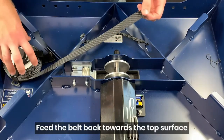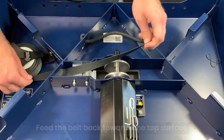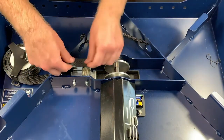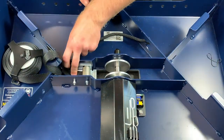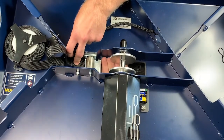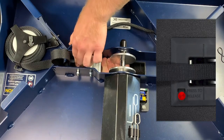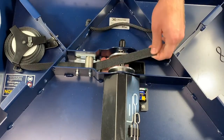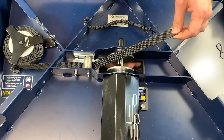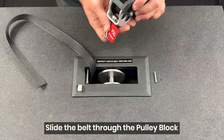You can see it's all wound up in there — just make sure it feeds in straight, and make sure to hang on to this edge of the drive belt. I'm going to feed this through here, tilt this up, push the belt release button, and get it fed through the one end. Grab it, pull a decent amount through, let the button go, and then flip it right-side up.